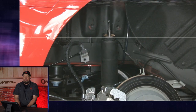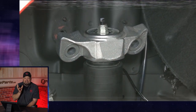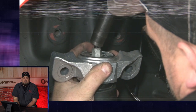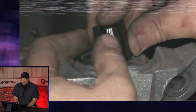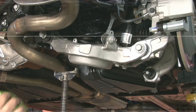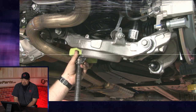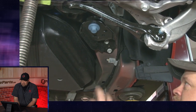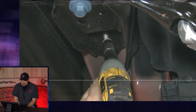I still suggest doing one side at a time. People have asked if you can lower the whole subframe at once, but the reason I do one side at a time is so you don't lose alignment of that subframe. We carry the Steeda kits that actually align it so it doesn't move, which is a great thing to have. But if you take it all down at the same time and put it back up, more than likely your subframe is going to have to be moved around when you have an alignment done, which will probably end up being a more expensive alignment. So one side at a time is still the way I recommend. Disconnect, go underneath the car, remove the subframe bolt so we can lower it down to install the spring. Support the subframe with a pole jack. I considered removing all four bolts and moving it down evenly, but then I thought the subframe would move with no way to get it right back where it was — even if we marked it. So we decided to do it one side at a time, and it worked, and to this day is still the way to do it.